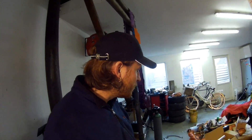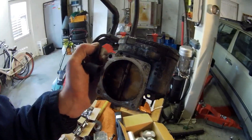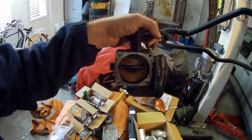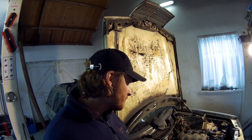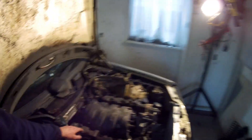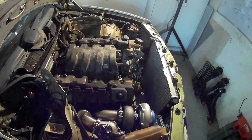There will be different — bigger — injectors in this engine. I'm going to use the same fuel line, so the throttle body needs to be repositioned so I can use it. Not big problems. This is part one of the manifold. I first need to make some parts, so there will be a part two of the modification. I also need to make new lifting points on the engine — normally they're in the back. I'll make two connection points here so I can also lift from those bolts.